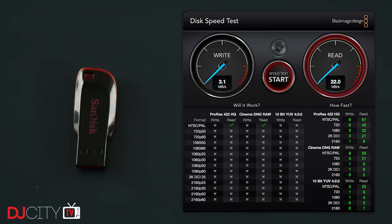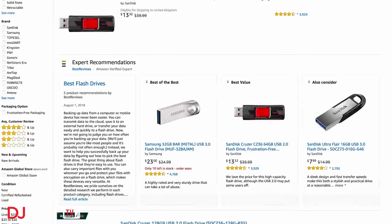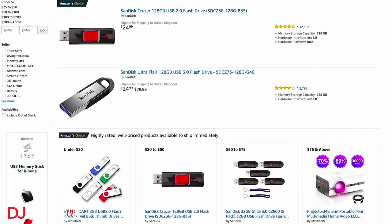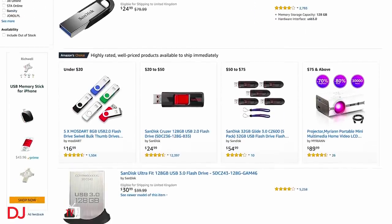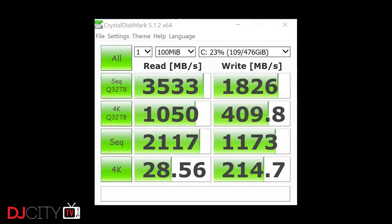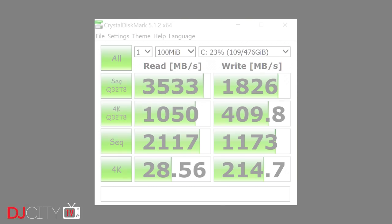So how do we know what is actually fast? I generally suggest you buy USB sticks or SD cards from Amazon — and not third-party sellers, just Amazon direct. When you look at a stick you'll usually find charts like these in the reviews. This is a CrystalDiskMark test, which gives you a rough guide to the real-world speed of a device. It's a free app for Windows if you want to check your existing media, and I'm using Blackmagic Disk Speed Test on the Mac, which is also free.